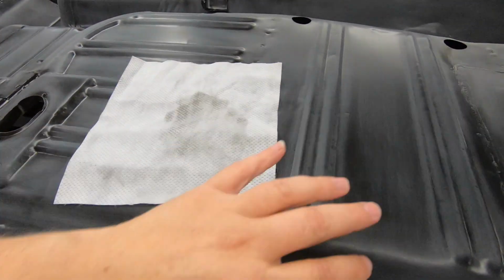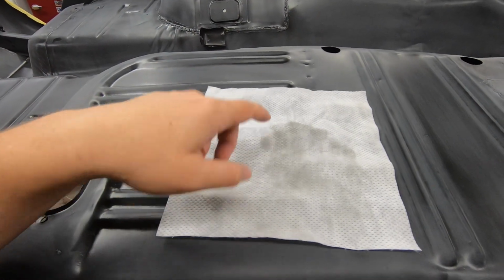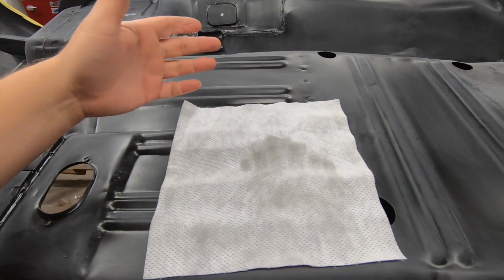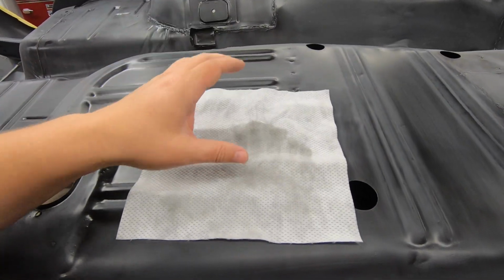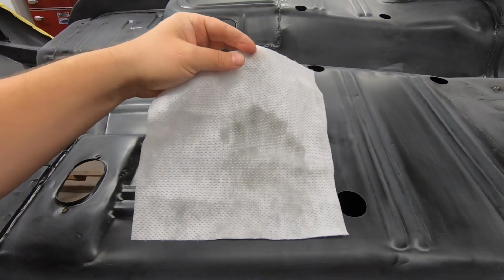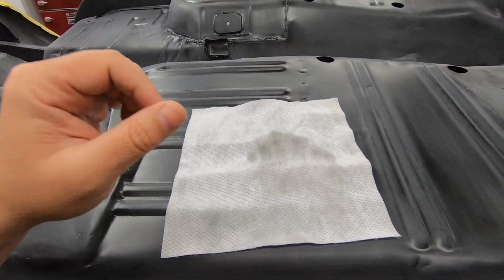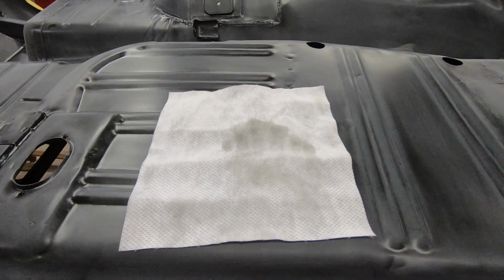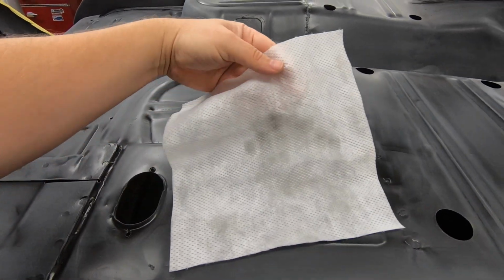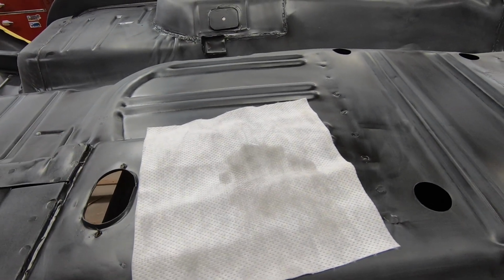The thing is, when you're cleaning anything like this, you wipe it down and say, oh yeah, look at all that dirt I picked up, and you think, oh hey, I'm done. You're not done. You're not done until you do this with cloths, whether you use the dry stuff, or wax and grease remover, whatever you use on it. Anytime you're cleaning anything, you're not done until you take rags, and when you wipe it, they come off looking just like they came out of the box and nothing's on them. That's how you know you're done, when there's absolutely nothing being picked up that you can see. So that's the best practice. Whether that happens in the real world, that's a different issue. But that's what you want to see. So I am going to be wiping this whole thing down numerous times. So let me get to it.